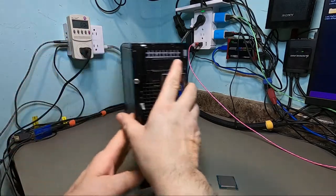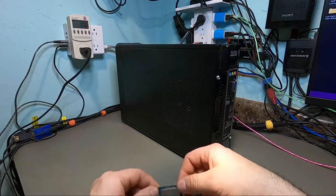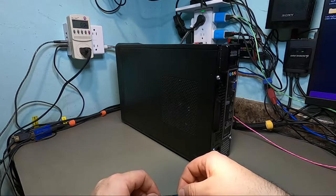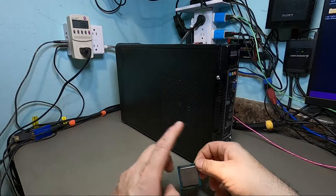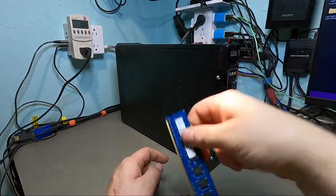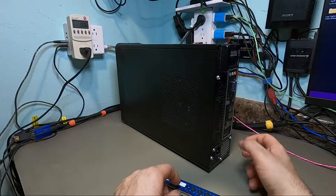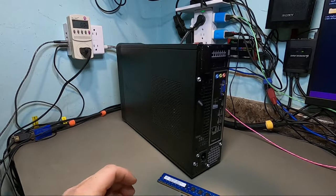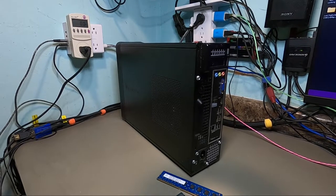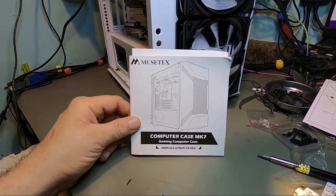So we're going to take the 660s and turn it into a gaming computer. I've already done a little bit to it — I flashed the BIOS to the latest updated BIOS, the A13 I think, maybe A14. I also upgraded the CPU and put in a Core i7-3770. Here's his old one I took out, and here's the old memory stick — it was a 4 gig stick. I have 8 in here for now, but we're going to bump that up to 16. Let me get this out of the case and we'll switch over to the new case.